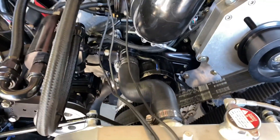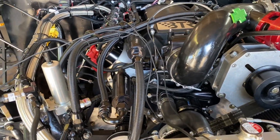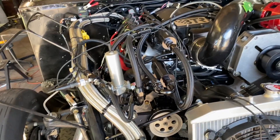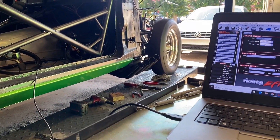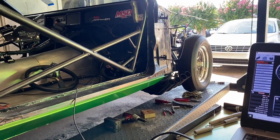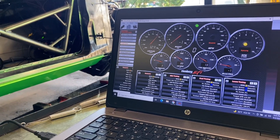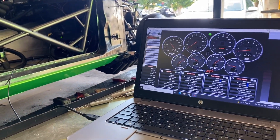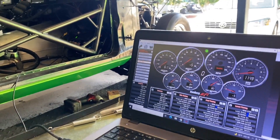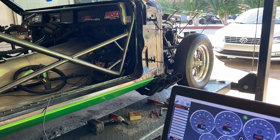The problem is the whole reason he's doing this is because the Dart block apparently isn't machined correctly, causing loss of crank signal. You've got to modify something — either the block, the crank signal, or the crank sensor. It's very frustrating. We're on LSX 58-tooth with the 4x cam, coil-on-plug. We're going to start the data log and try to fire it.